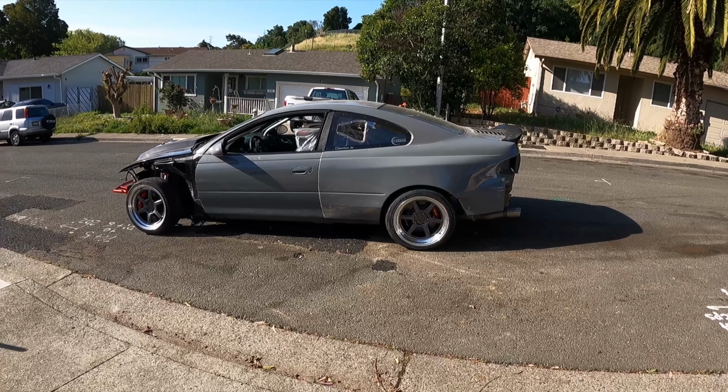But I like how low it got. Louis took out the spacers while I was gone. It's a little lower. It's not as low as I would like it, but good enough. It's on half a positive degree of camber, and we have a little bit of toe in the back. Hopefully it'll have a little more bite, but we'll see. So I think I probably should corner balance this thing. I'm not sure, because this side looks like it's sitting nice.